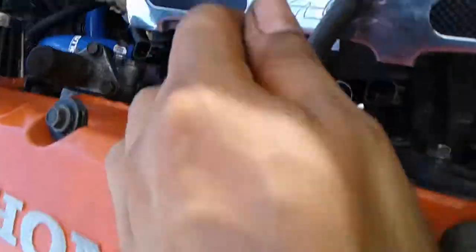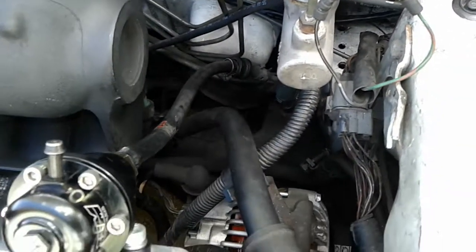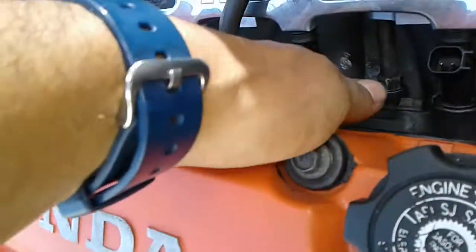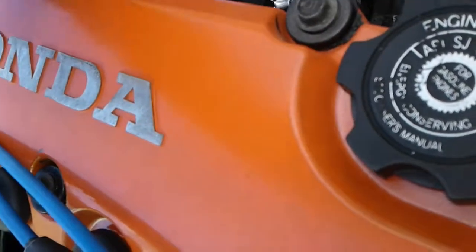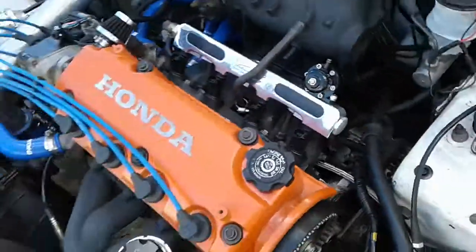You can see there's still a little gas I spilled back there. I ground that down — not even a quarter inch, maybe a tenth of an inch — just so the fuel rail could sit a little lower. Incredibly, the fuel line still reaches fine. You can see the grommets are nice and tight in there, hopefully creating a good seal with no vacuum leaks for the boost.